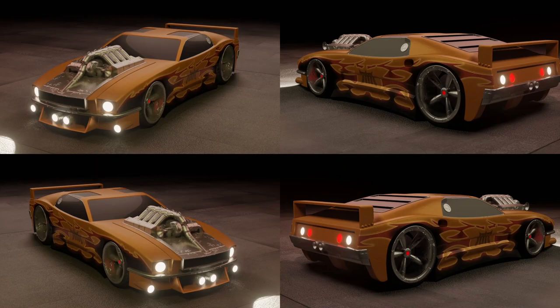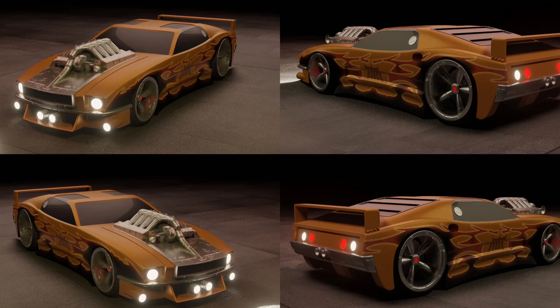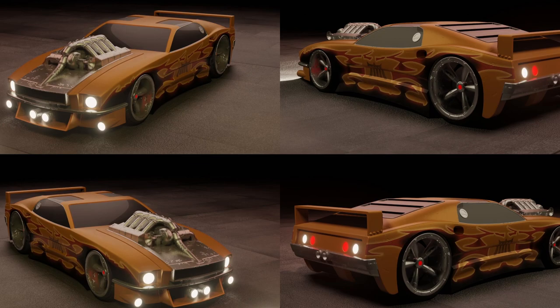All right, and now my personal favorite part of this build, which I am so pumped for. That's right, we are talking about the motor. Now, this is not going to be an easy task, as 800 horsepower is neither easy or cheap. On top of that, the wiki is very specific about the motor, so there's not many liberties we can take. We know it's got to be 815 horsepower. We also know that the motor is a 427 big block, which rules out any stroker kits or boring the cylinders. We also know that it's fuel injected, so it'll have to be either a modified carbureted vehicle or a brand new LS engine.